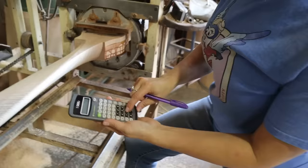Okay, so this is a prop flange, and this is your bolt pattern. And these are, when you ask for your counter bores, this is the diameter that I'm asking for. So you have your prop bolt that goes in here, but this is your counter bore, your drive lugs. There's lots of different names for them. But basically, we need to recess the prop for those to sit in there. And they're just extra centering pins is all they are.